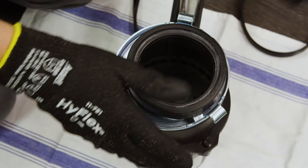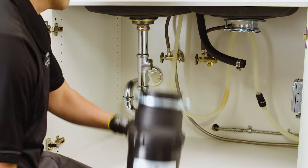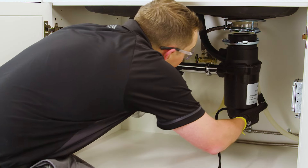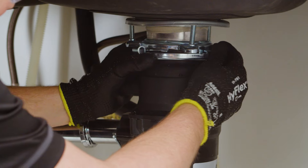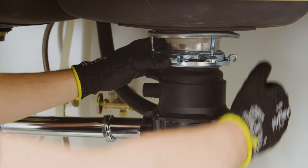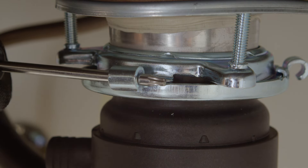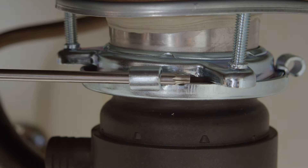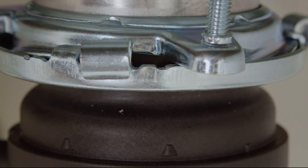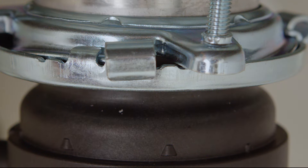You can now connect your garbage disposal to plumbing. Turn the disposer until it lines up with the outlet drain pipe. Next, lift and prop the disposer into place on the upper mounting ring. Mount it by turning the lower mounting ring until its tabs engage onto the slide ramps of the upper mounting ring and turn until snug. Insert a screwdriver into a lower hook and leverage it counterclockwise further into place. Use channel lock pliers to fully lock the lower mounting ring tabs onto the upper sliding ramps. When it locks up tight, your new disposer is now in place.